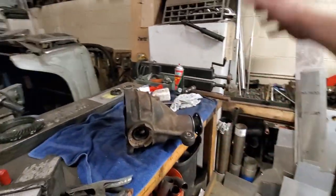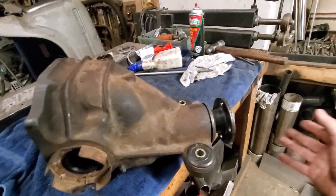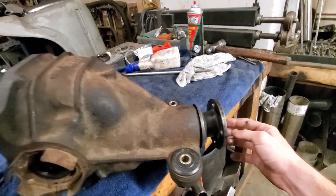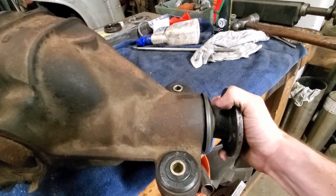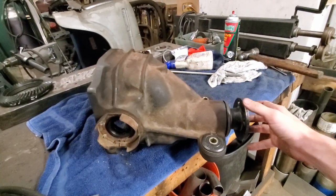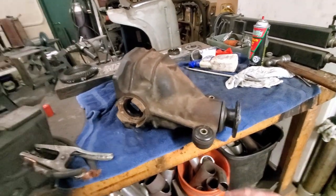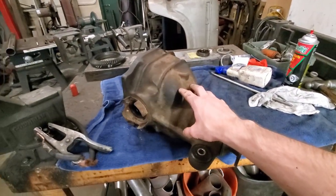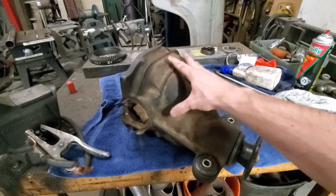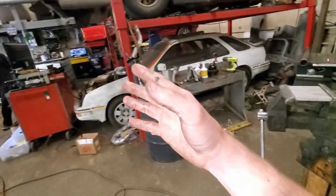So we're at the point where before I had to go get the new bearings - this is where we were. Typically, even when we had the nut sucked in all the way down, it still had play forward and back, which you're not supposed to have. There should be a preload on the two bearings. That's why I went out and got new bearings. We don't know if this is going to work off the rip - this is the first early-style R200 diff that Liddy's actually done, and I've gotten a hold of a lot of people and they have not done this in this specific early-style R200 diff. We're kind of the first pioneers trying to make a different gear ratio in this diff.